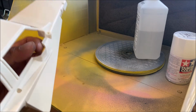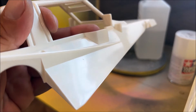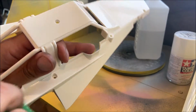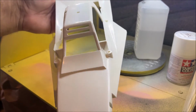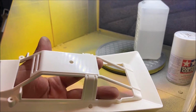So if your hard paint job bodies aren't coming out good, it's because they probably have contaminants on them. See that? Now, we washed this really good with Purple Power, but there's some kind of oil and crap on this one. Go back with some alcohol and a microfiber and look down this body before you just go throw some paint on it. See, we still have some of that contaminant looking stuff up there.